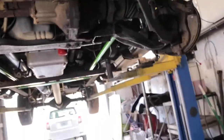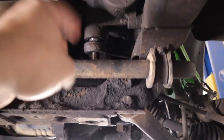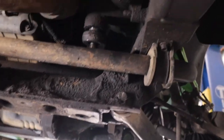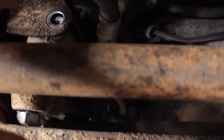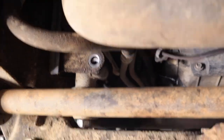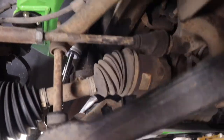Just to get you guys caught up — after you get the tie rods loose, we went ahead and got the idler/steering arm loose with an adjustable wrench. Over here there are two bolts, 21mm — take those two out. That's where the new support bracket from Kryptonite goes back into. We also got this nut loose and we're now going to use a pickle fork to drop the tie rod and sway bar — everything else is loose and ready to come off.